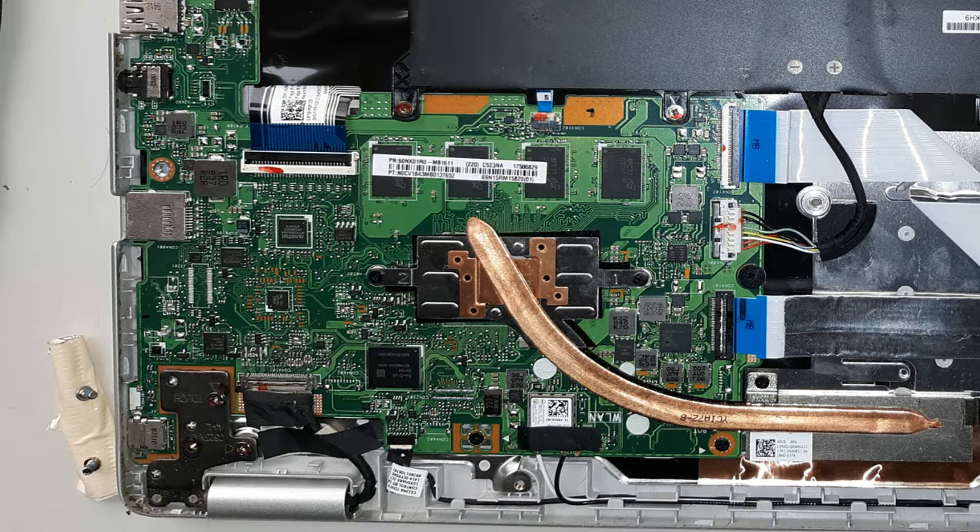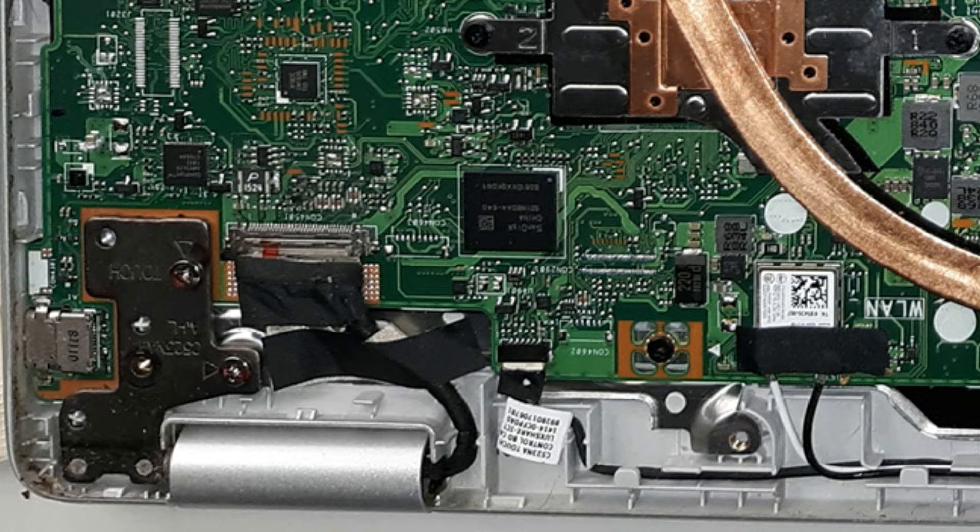On the motherboard we see the RAM, which is soldered on, so it's not user upgradable. We also have the CPU heat sink below that, and the heat pipe that goes through — that's all part of the cooling system for the CPU. Below the CPU we see a small chip — that's actually the storage. This one came with 32GB of solid state storage, also soldered on to the main board and therefore not easily upgradable by the user. Below and to the left of the storage we find the display cable.